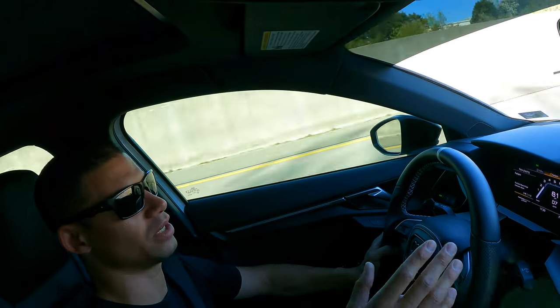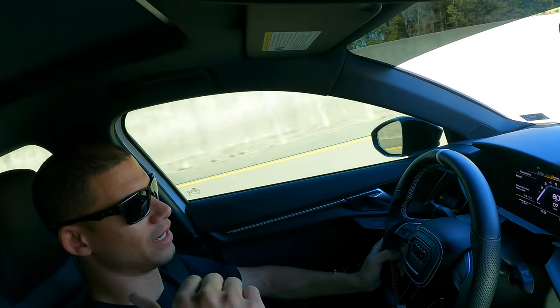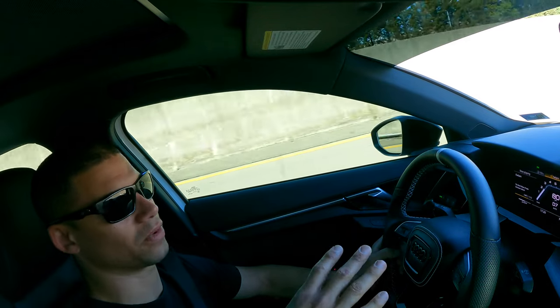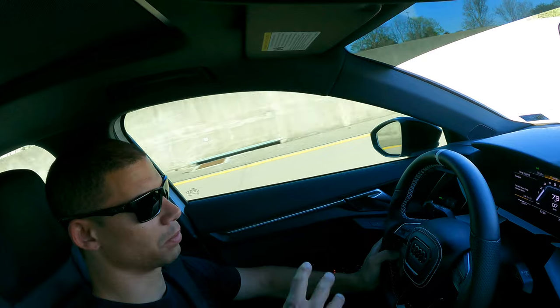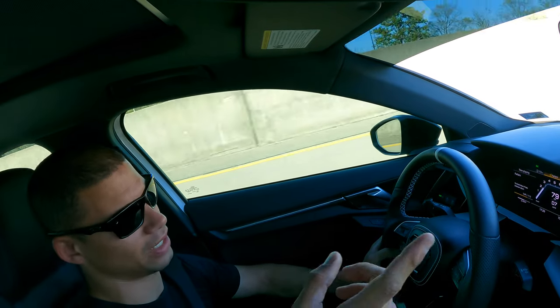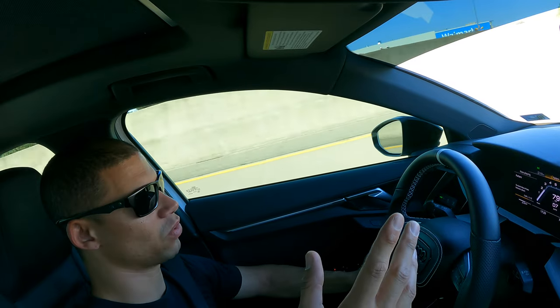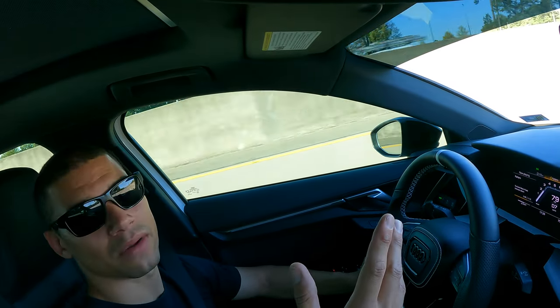It's not perfect. I still need to make some adjustments. It really needs coilovers. My strut tops are blown. My rear end links are pretty crap. I've had them in there for a long time, and they're pretty rusted out from all the salt and years of debris. And in the front, one of my front end links has a torn boot. So I've got a couple things that need refreshing. Definitely need coilovers sooner than later, but I'm gonna let them go out and beat on the car.